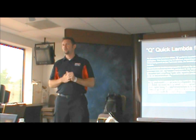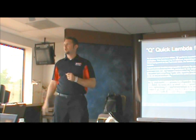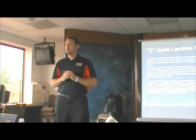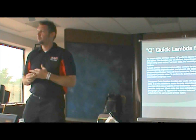I have the dyno operator on an engine dyno hold it at 3,000 RPM, work up to 100% throttle, and then make a pull. And we do that straight away. We don't have to work through part throttle sections of the map. You can get right into the heart of what happens. Two pulls, the fueling is done, and we can start moving on to timing.